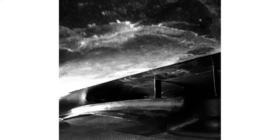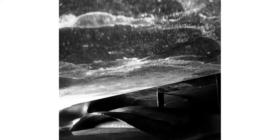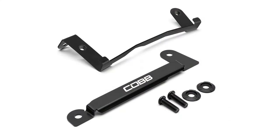If you don't already know, the flimsy plastic and rubber factory intake scoop components will drastically collapse under the pull of those twin turbos once they spin up. This carbon scoop is far more sturdy, and the kit comes with the Cobb intake scoop bracket to fully negate that factory flaw.